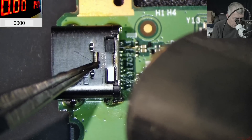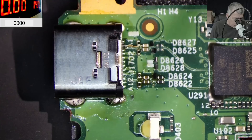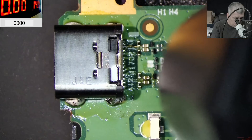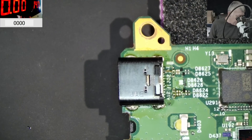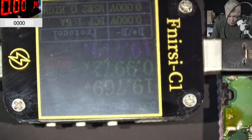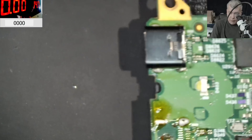I'm going to hold down the charging port. Let's cool down. Let's plug a charger — USB-C and a meter — and see if the port is working. Plug in the charger. The meter is coming on: 19 volts, 1 amp, so probably the board is starting. I can feel the heat on the heat sink. I can move the port up and down and it is solid. 19 volts, 1 amp — this port is done properly.